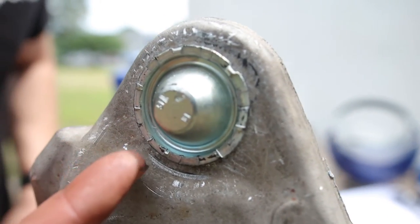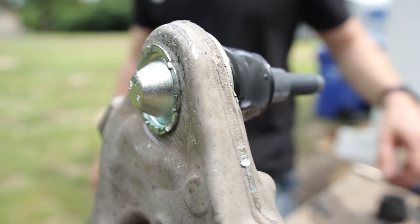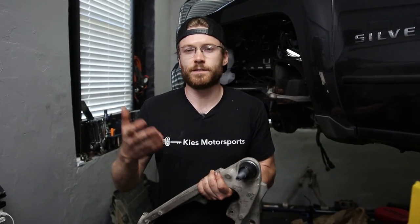And that's how you install a ball joint — you can definitely do this by hand. So that is how you replace the OEM style ball joint in your lower control arm. Now there are different types of aftermarket ball joints that you can purchase which would not require flattening the top out to lock this in place, such as Moog and some other brands.